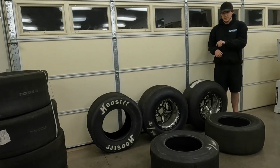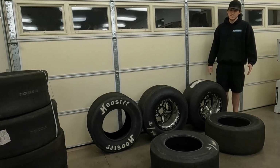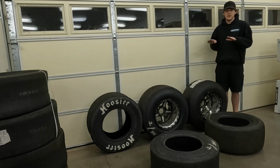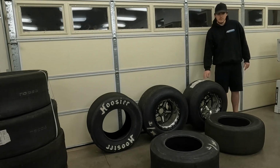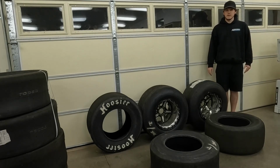So we're hitting it harder with that separation, pushing it down into the ground, helping the car get a little bit more traction while it accelerates. And also we are doing that in order to try and push the front of the car down in order to avoid wheelies, because that car is not very heavy on the front end. So making the power it is, running a radial tire and really getting after it, we wanted to make sure we avoided wheelies.